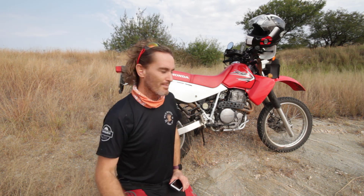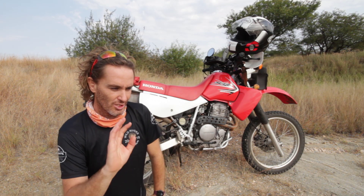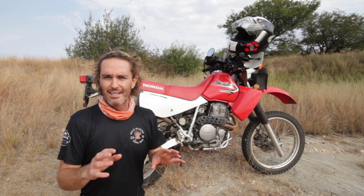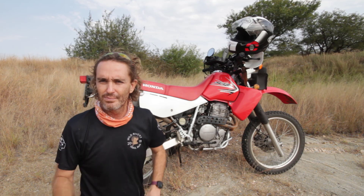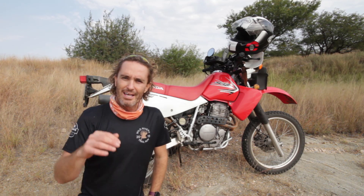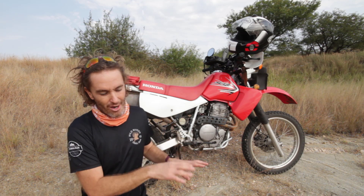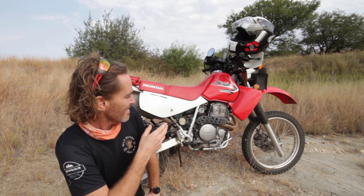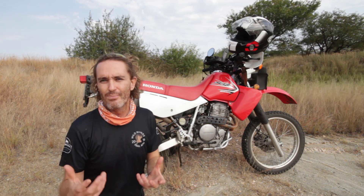The other guy was keen to swap and I was excited to swap, but then I saw something that swayed me. The first thing: on the DRZ, the valve clearances are set with shims, whereas on this you just adjust with a screwdriver and a box wrench. I already know if I swap, I'll start worrying about finding shims and whether the clearances are correct. On the XR I've already set them — it took 10 minutes. I like the lower compression, easy valve adjustment, air-cooled, less to break if you drop it.